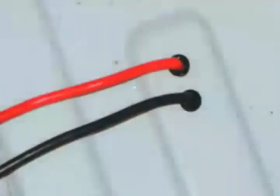Plastic grommets are used to prevent chafing of the wiring against the metal flooring. Snap the grommets into the holes. Push each wire through the grommet until all slack is out and the wires are tight to the floor. Tape the ends of the wires together to help when routing the wiring.